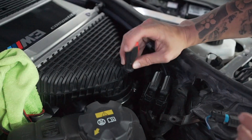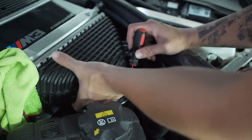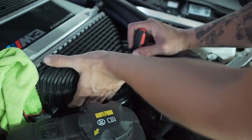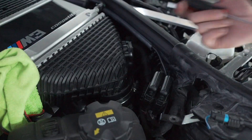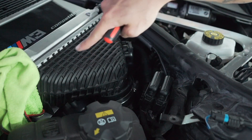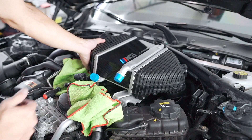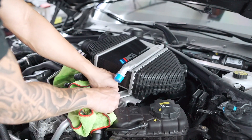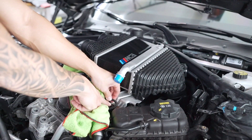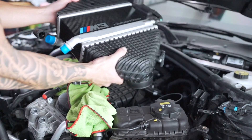Take the pick tool and lodge it in between the silicone coupler on the J pipe — that gives enough leverage to lift the charge cooler out of the J pipe. Now everything's pretty much loosened up; the only thing holding in the charge cooler is a couple of rubber grommets underneath. Pry the left side up from the rubber grommets, disconnect the little hose there, and you should be able to lift the entire unit out of both sides of the charge pipe.